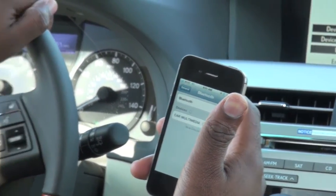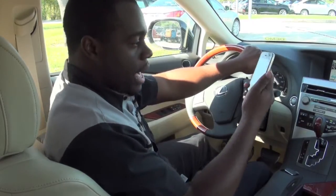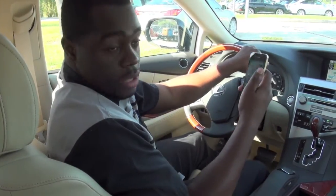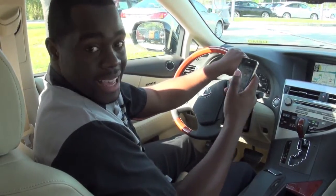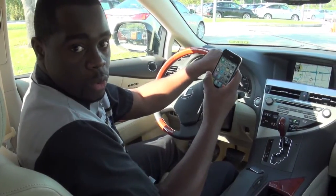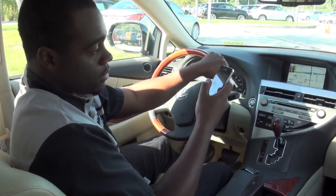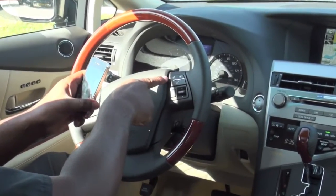And it's all connected. Now that we have our iPhone 4S connected into the Lexus Bluetooth hands-free system, you have the ability of transferring all your telephone numbers directly from your iPhone into the Lexus navigation system. But before you do that, if you're utilizing the iCloud feature, you may either want to turn it off or contact your local Apple store — to avoid duplicate names being added into the Lexus navigation system.